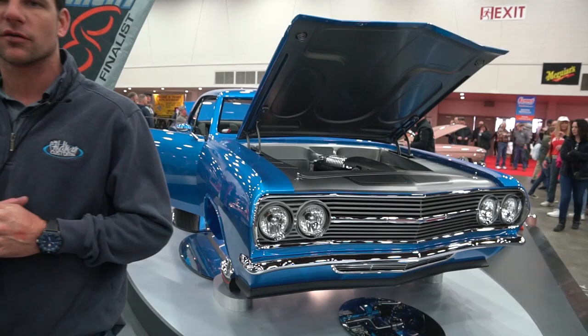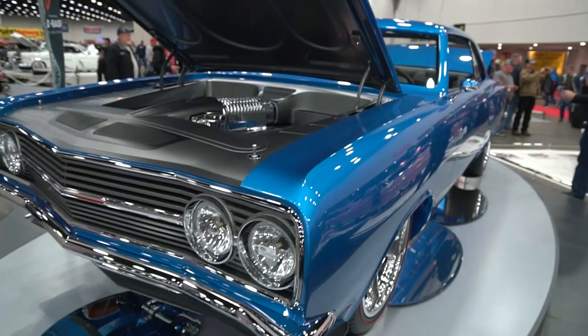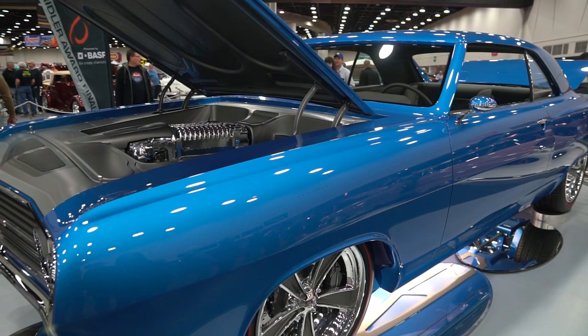The name of the car is Reflection. We basically wanted to take a stock car, change it up and modernize it like we would have wanted to do in 1965 — just smoothing the lines up, changing the roof. We put a '66-'67 Chevelle roof on it, took three quarters of an inch out of the A-pillar. The windshield and the back glass both come in from the inside. Lots of metal work done around the A-pillar and the cowl where the glass meets it, just to clean it up and modernize it.